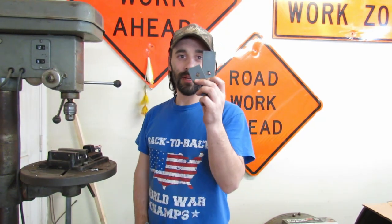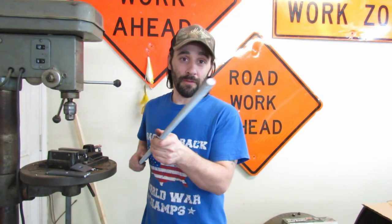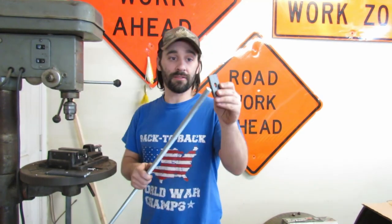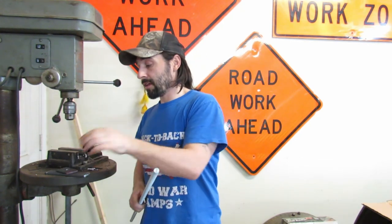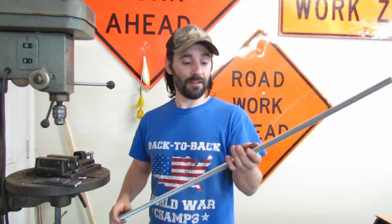Drilled out to a half inch, and we need to be at 5/8 inch for our 5/8 threaded rod because this needs to fit through there. And I can't seem to find a 5/8 drill bit anywhere here at Freeman's Garage. We're not going to just do the whole reamer thing because we need this to fit tight. We don't want it to be all loosey-goosey and have this stuff strip or snap in our face.